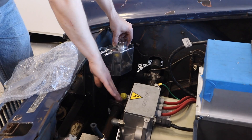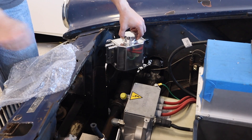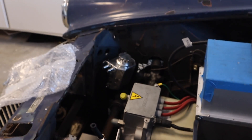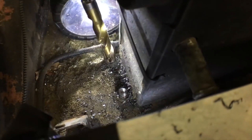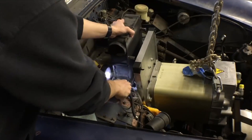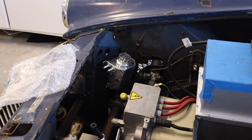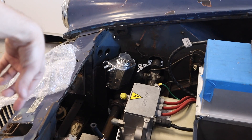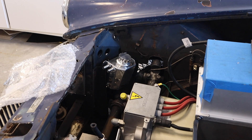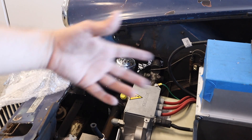Something like that — keeping these runs nice and short. A lot cleaner. I think that might be one good spot there. I'm trying to repurpose the heater core that used to live over here — you saw us remove that in a much earlier video. Got it cleaned up and we're going to try and see if it's enough of a radiator. Effectively that's what that is. If you're not familiar, the ability for your car to heat its interior cabin is just a second, much smaller radiator that lives underneath the dashboard. It takes hot coolant off the internal combustion engine and radiates it into the car. They run a fan to move air across that element. So we're trying to do the opposite here — have it on the exterior of the car, run hot coolant through it, and shed some of that heat.